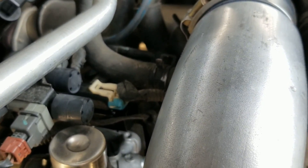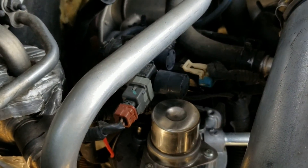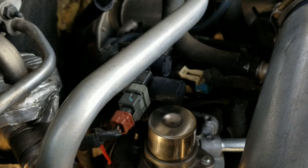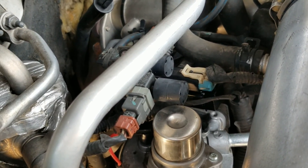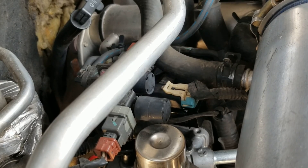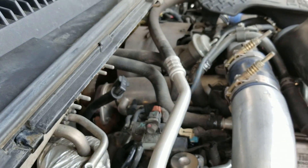Hopefully this helps you — if you have any questions let me know. Another thing to look out for: if you get a barometric pressure issue, mass airflow issue, and EGR issue, or a combination of those three — one, two, or all three of them — make sure that these vacuum lines are correct, because that is a very major thing I realized when it happened to me. Best of luck, hope you enjoy.